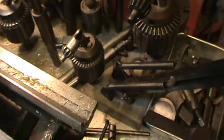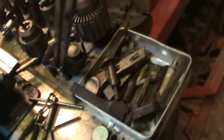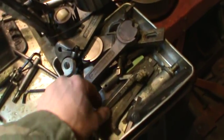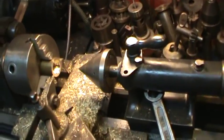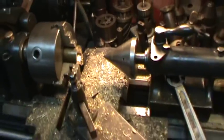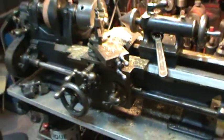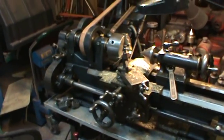Somewhere in here is the boring tool - the boring head. I put that on there and cut out the center, and that actually worked quite well. I got them dead nuts - absolutely no play whatsoever. I was probably on this for about two hours, just whittling away, getting an education on how to use the lathe - high speed versus low speed according to what you're cutting. Big pile of brass underneath there. I could have bought the bushings for 10 bucks, but I didn't have to wait and was able to take it apart and get it back together the same day.